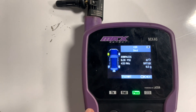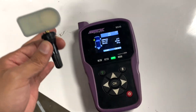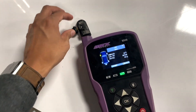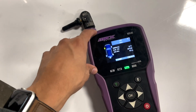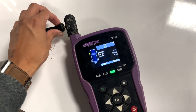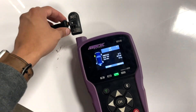I went ahead in my programming tool, selected Kia Soul 2021, and programmed it to see if it would scan — and it works. It reads zero PSI because there's zero pressure, but it reads. My recommendation: if you buy these sensors, program them first, and then ask your tire shop to confirm they all read before installing them, to avoid having to redo work.